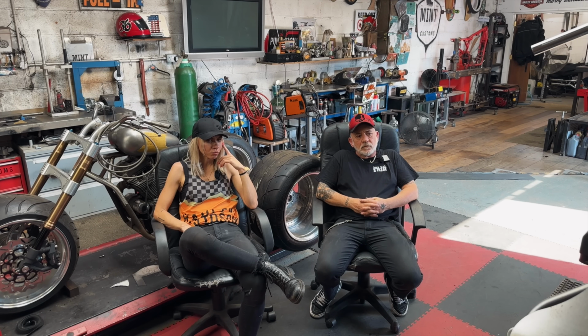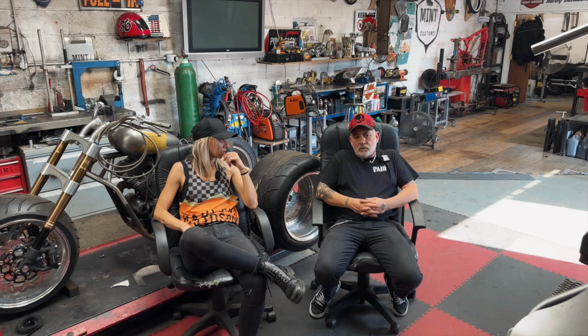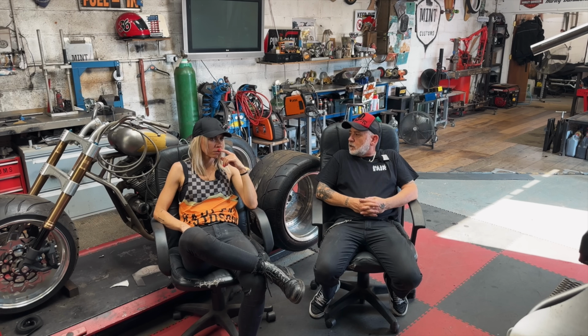I think because we have a sheet of aluminium in the house, I can do a fender next. Because that will need a bracket as well. The bracket where the sissy bar comes off. Bracket on the sissy bar and a bracket off the frame. So how about now I will concentrate on rear wheel, doing the brake, the fender and the sissy bar, sorting all that out. Yeah, that's an ideal suggestion. And I'll get a tank as well. That's going to need a little cut and shut on the tank. That's not a direct fit, because you want to do a funky tank mount on that. Bar up the front there.